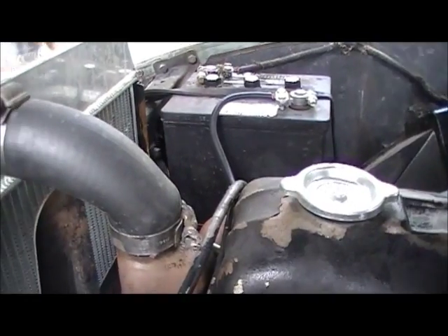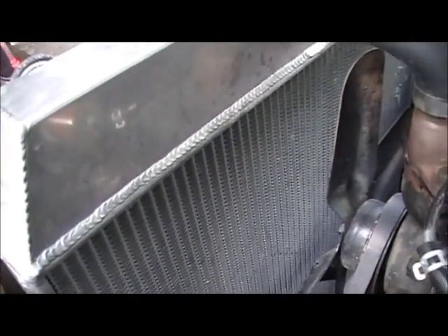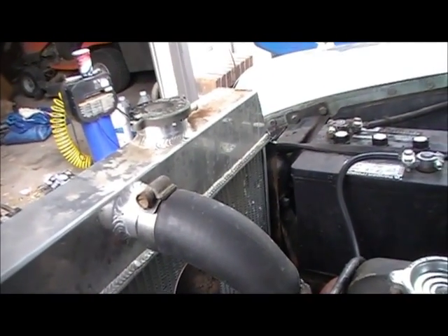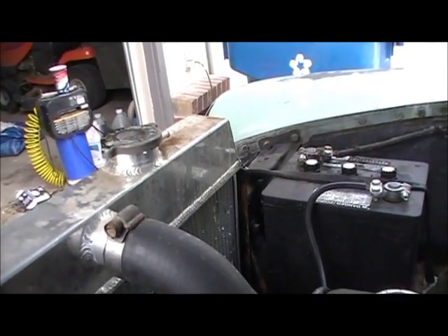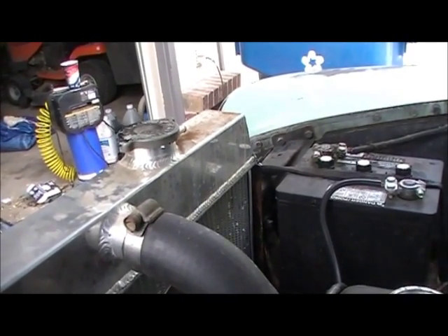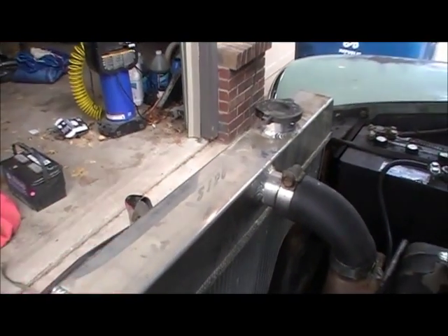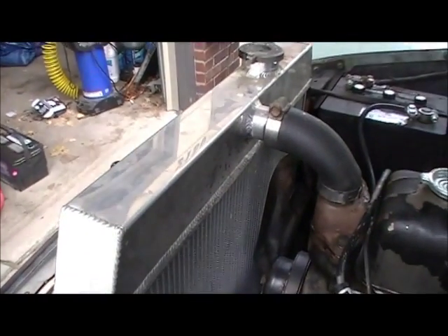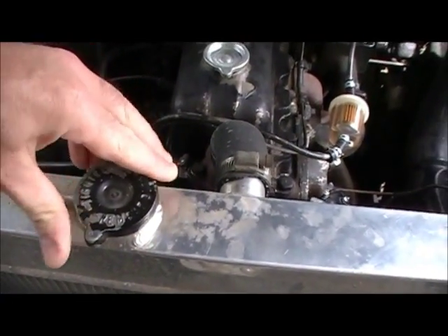So you're going to have to change out your thermostat housing to the inch-and-a-half size instead of inch-and-a-quarter, and you'll probably have to redrill all new mounting holes. But other than that, I've been really happy with this. For $176 shipped to my door, compared to $350 to $600 here in town, or about $300 online, this was half the price and it's serving the job really well.